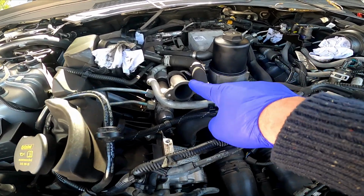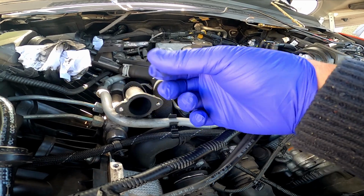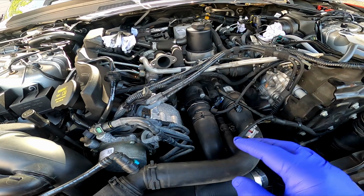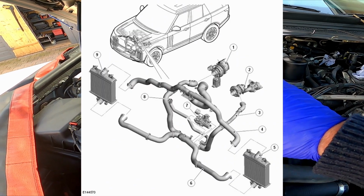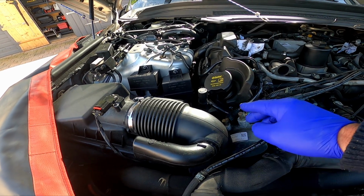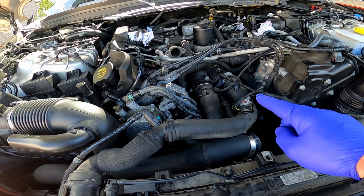So we've obviously got the EGR system, exhaust gas recirculation, where exhaust gas is coming back into the inlet here. And this is generally quite dry material, not oily, just as exhaust would be. However, what's causing the oil and the carbon is how the turbos are working. So on this side of the engine here, we've got the variable geometry vane turbo, which is the primary turbo which runs all the time. So the inlet air is coming in here, going down, feeding into the compressor of the turbo, which is then fed back through the intercooler, up through these hoses and into the inlet.